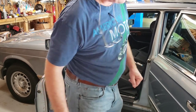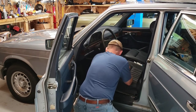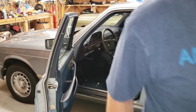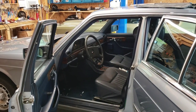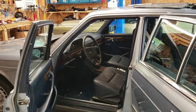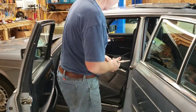Let's get those two covers off there and get those other two 10 millimeter bolts out. That was pretty painless. All we have to do now — well, we run into the camera. All right, let's see what we have to do here. Same deal as the other side — I'm going to take that little clip off the seat belt rail.